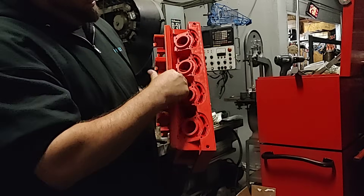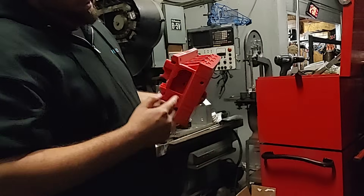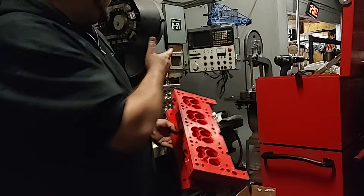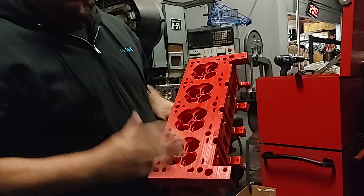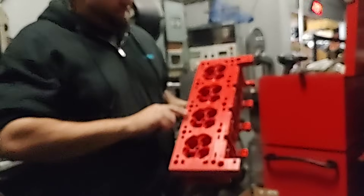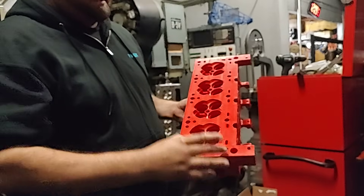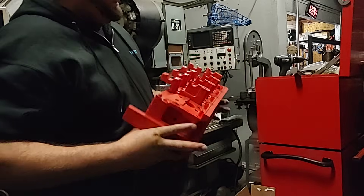I hope you can clearly see — with my wonderful shop lighting — that there are these deep wells in between each cylinder, under the exhaust port. At the ends of the head, they are angle-drilled through in all kinds of different ways, hence the trunnion table. This is basically a bolt-on head that's fully billet with a lot of CFM.